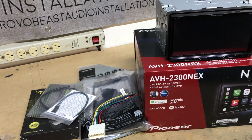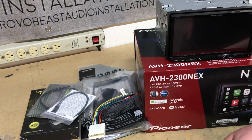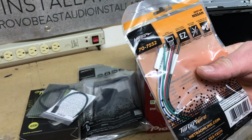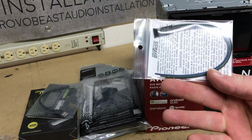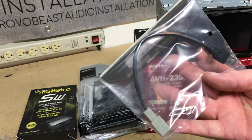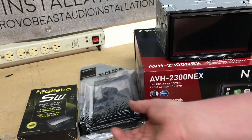Now in this install today, we're going to be putting in the AVH 2300 NEX. We will have an unboxing for you. I'll link in the description once that video is available. This is the Apple CarPlay and Android Auto unit. We have our wiring harness, the 70-7552. We have a micro bypass for video playback while in motion. We have our USB retention cable. This allows us to keep the factory USB in the glove box.